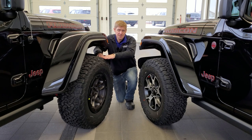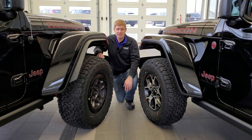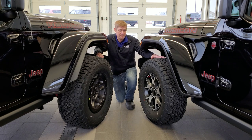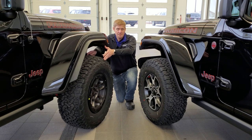There's also a height difference. If you go to tiresize.com/height-calculator, you can punch in these numbers and get the figures I'm about to give you. On the Extreme Recon, the tire height is 34.4 inches high and 12.4 inches wide. On the non-Extreme Recon package, it's 32.7 inches high and 11.2 inches wide — so that's 1.7 inches taller and 1.2 inches wider on the Extreme Recon package.